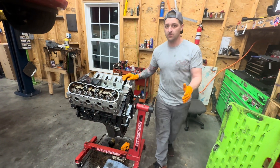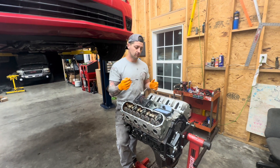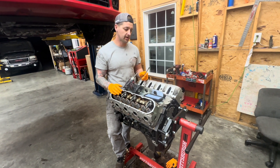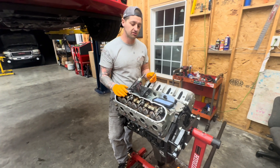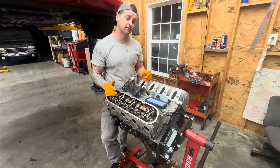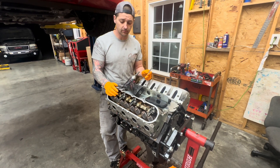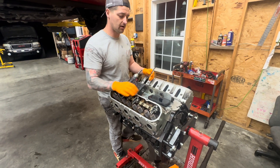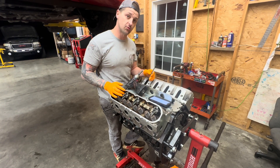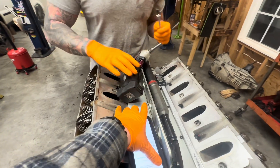The first step is to contact your manufacturer. We contacted Michigan Motorsports regarding these LS7-style lifters and checked their preload recommendations. I usually run about 80 thousandths, but they said these can go anywhere from 40 to 150 thousandths, with up to 220 thousandths available. For reference, an LS7 out of a Z06 comes with about 120 to 130 thousandths preload on the lifters.